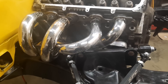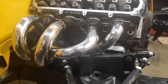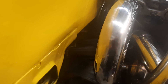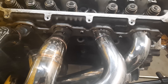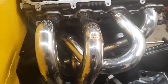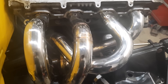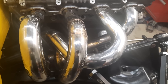Taking advantage of this car being a completely new build and naturally aspirated, we wanted to try out this new configuration. We placed the shortest tube in first, determined the position of the collector, then built the longest tube, and then filled it in in the firing order. That's how we created this arrangement, and we took a lot of time to build these headers accurately. We will do a bunch of dyno testing and hope to compare them to a different set of headers at some point.